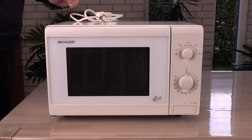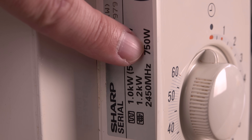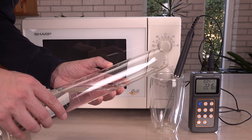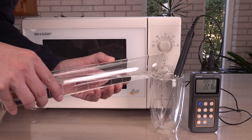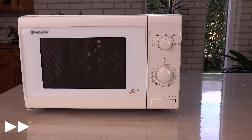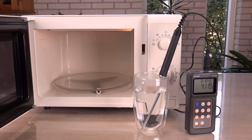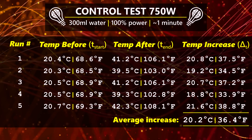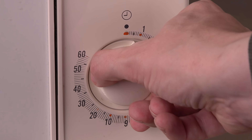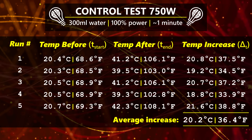This is my oldest microwave. It is likely decades old but had an output of 750 watts of microwave radiation when new. Before I put the huge magnet on it, I want to see how well it heats water under normal use — a control test to compare with. I tried five times with 300 ml of water placed at the center and heated at full power for one minute. The result is not perfect, probably because it is impossible to get exactly one minute with this manual dial every time.